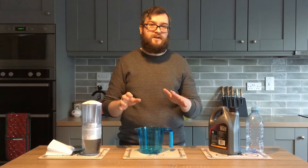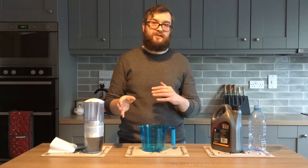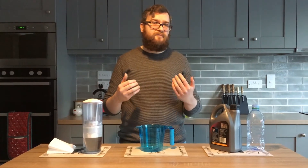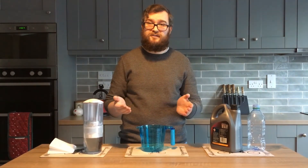However, I wouldn't really recommend going any less than the minimum requirement — so the 20-80 mix of 20% concentrate to 80% water — because you still actually want that cleaning effect. If you dilute it too much, you may not have the cleaning effect that you're looking for on the windscreen, especially if there are any bugs or insects stuck to it.